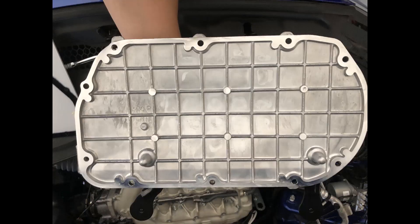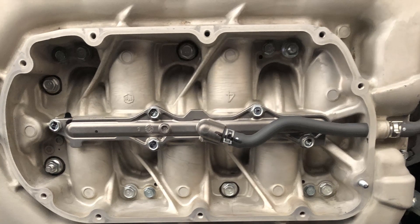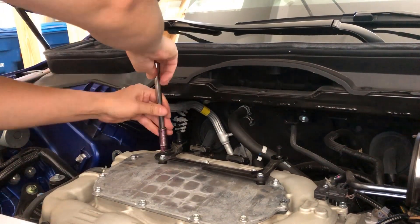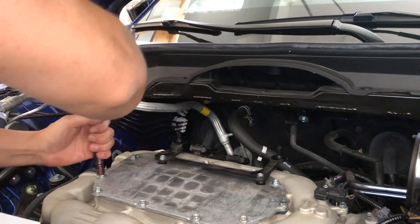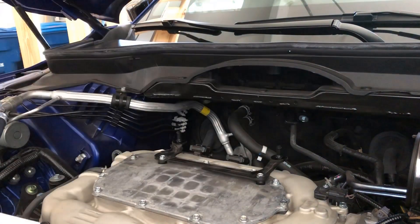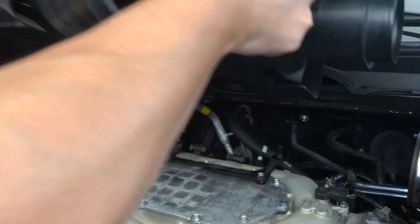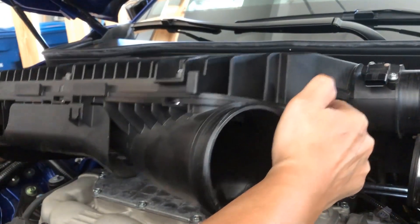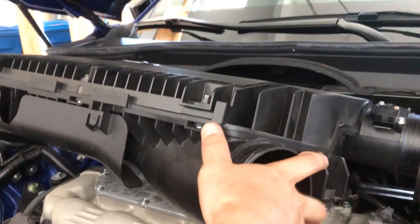The problem is that the new intake manifold design for the 2022 MDX is actually closed off for the intake runners — there is no open air there. So the supercharger sitting on top will not be pushing any air through the new intake manifold design. Now I have to decide whether I can source a new or used manifold from the junkyard, cut it up, and still create the plate to put the supercharger on top, or go with the previous year model J35 that has the plastic intake manifold and see if that one would be easier to cut up and expose the runners.